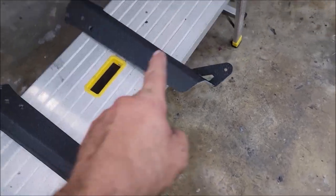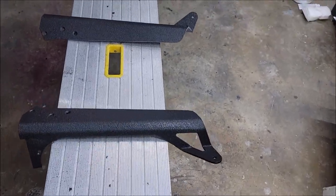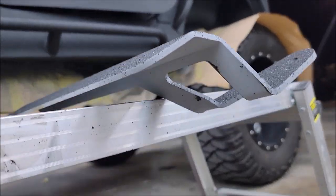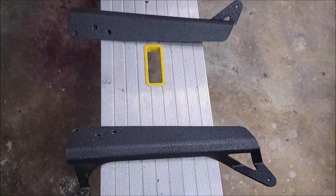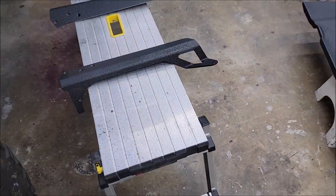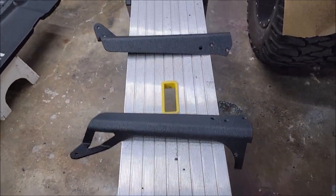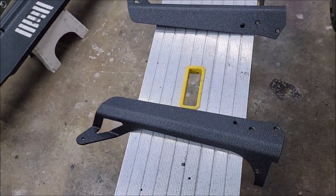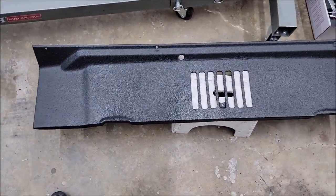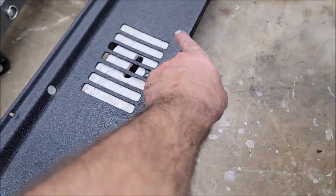I got these brackets done. I'm leaving for four days and I'll be back Monday to get this done — today's Thursday. I got to do the backsides of these still, but the fronts look great. These were peeling really bad — they were powder coated in a texture and peeling really badly. So I did my best to get them where they weren't peeling anymore, then sanded and primed. This is the cowl piece — I sanded the best I could on that one. You can still see some of the defects.